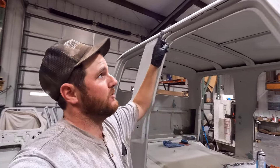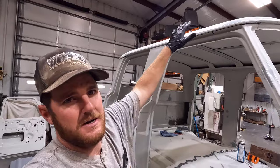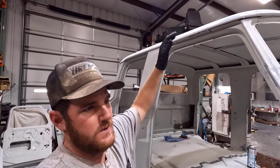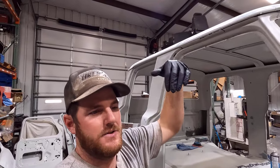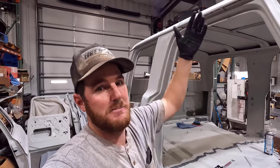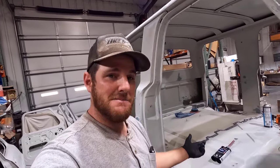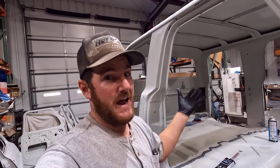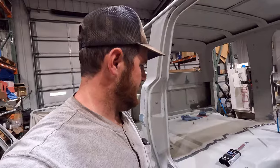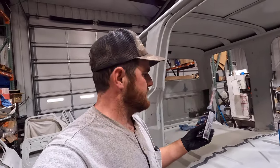This is primed. I did prime the hood with epoxy primer, but then I did some body fill work up on the edge where I did some metal work. So running that sander on that body fill, I did get direct metal on the drip rail there. So I'm going to reprime it, and you have to let that fully cure before you apply the seam sealer. I think it's 5 days before the epoxy primer fully cures out. And it does say on here it is direct metal capable, so I guess that's good.